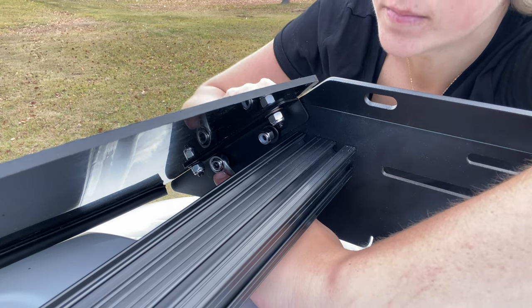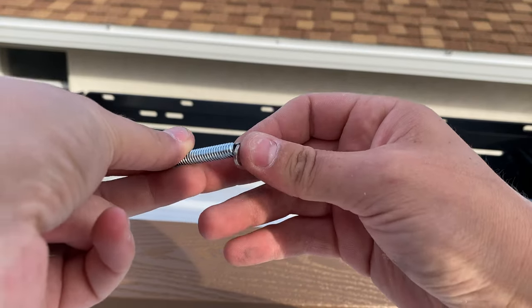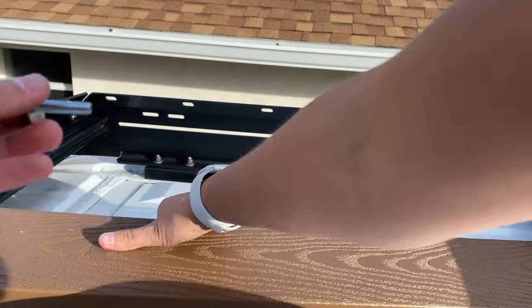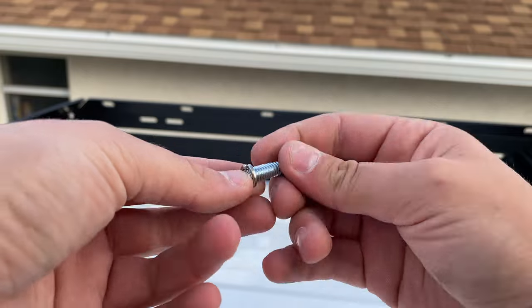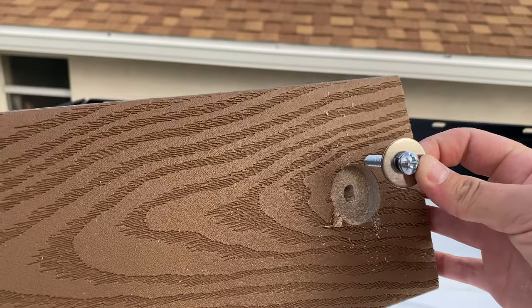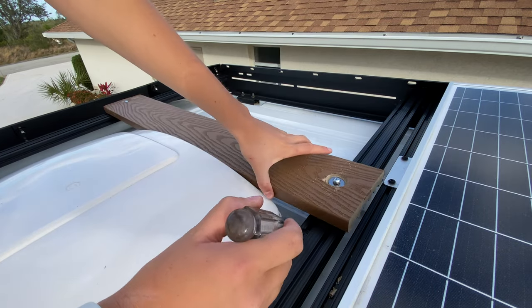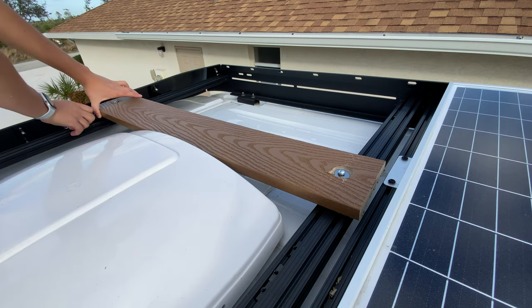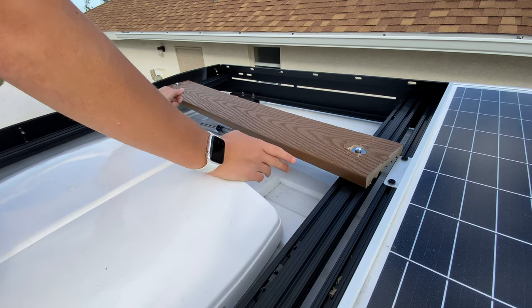Just a tip if you haven't installed your roof rack yet. I purchased the 10-series T-nuts from Flatline Vanco. I used 1/4-inch by 20-thread bolts that are 1-1/4 inches long, 1/4-inch lock washers, and 1/4-inch flat washers. The assembly order is: bolt, lock washer, flat washer, board, then feed into the T-nut in the crossbar channel. I found it best to keep the extra T-nuts in the channel out of the way so they wouldn't get stuck under the board — just move over one T-nut per crossbar to work with.